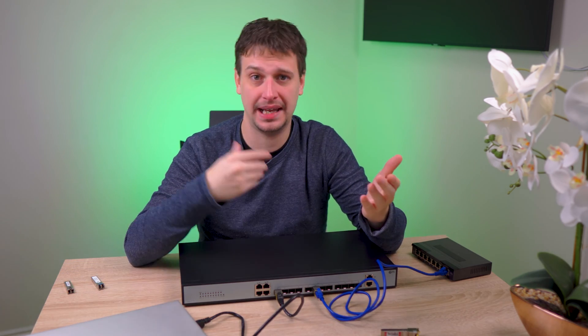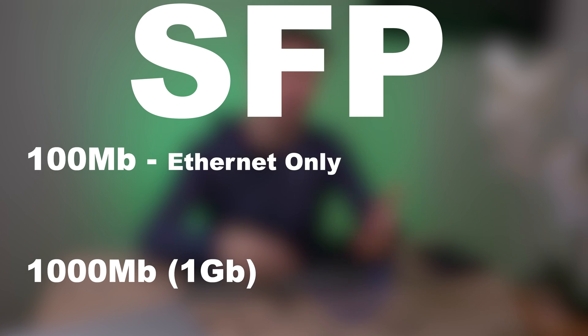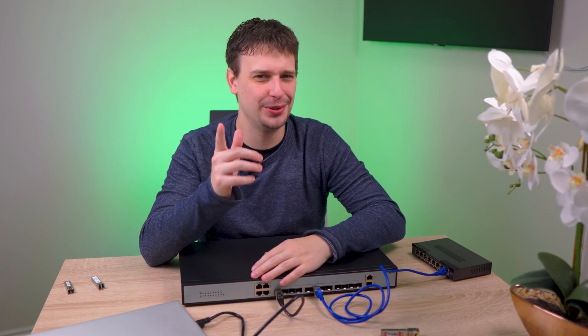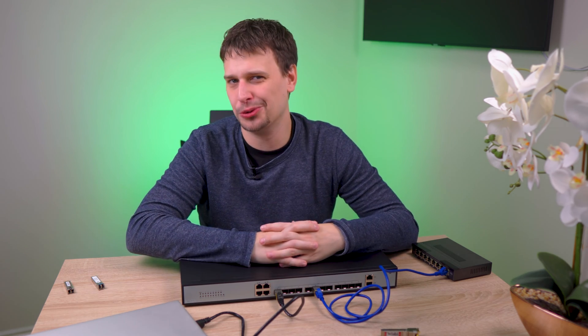Now you've heard me mention SFP and SFP Plus — there are actually a few more, and they're all to do with speeds and what kind of cable they can support. SFP will handle 100 megabit and one gigabit speeds — only 100 megabit over ethernet and gigabit with either fibre or ethernet. SFP Plus will do 10 gigabit over fibre, ethernet, or DAC. SFP28 has speeds of 25 gigabits per second but just over fibre or DAC. Why is it called 28? Apparently it's for encoding overhead, but when the usable throughput is only 25 it should be called 25, right? I look forward to your comments.